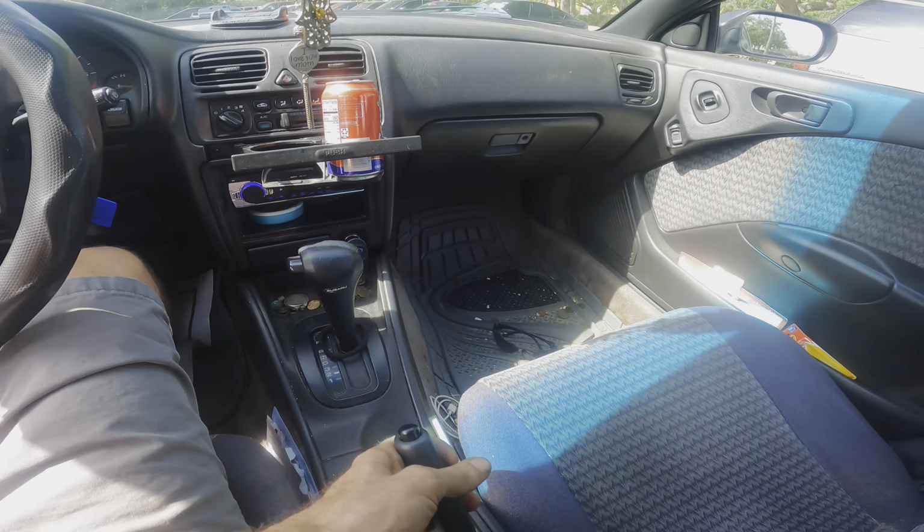Oh, wow. Oh, this is cool. Look at the threads right here on that brake line. See how they're nice and shiny and flat? It means those have been stripped, and that would have happened in the block right here. I can also see that the threads on this bolt are not the same pitch as the threads on the brake line, so that means they have damaged this block right here. That's going to be unobtainium.